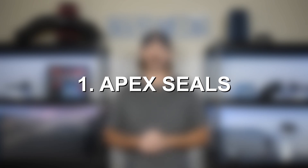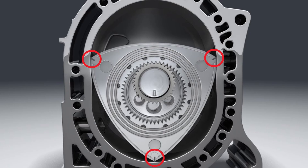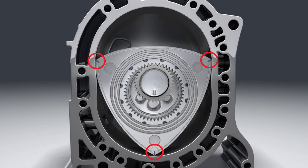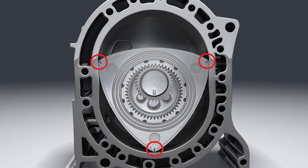So first off, there is one primary killer of any rotary engine. This is the same for the RX-7 and the RX-8, and that is the apex seals. When you think about a rotary engine, you have a rounded triangle that spins around in an oval rotary housing. There are only three points of a rotor that actually touch the rotor housing, and those are where the apex seals are located. Because those triangles actually contact metal, they have to be lubricated. On the end of each one of those triangular tips, you have an apex seal.